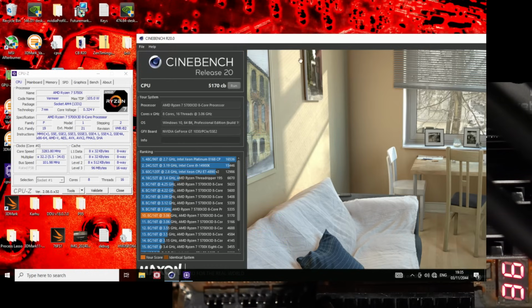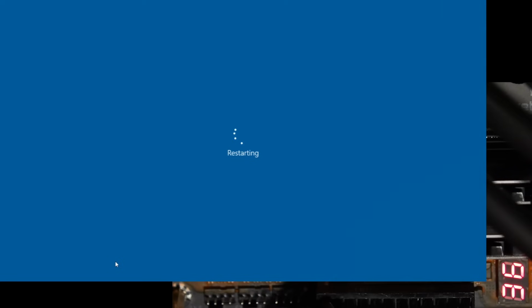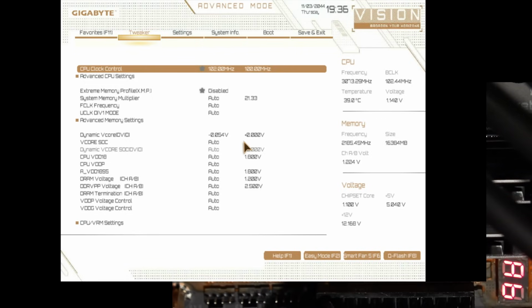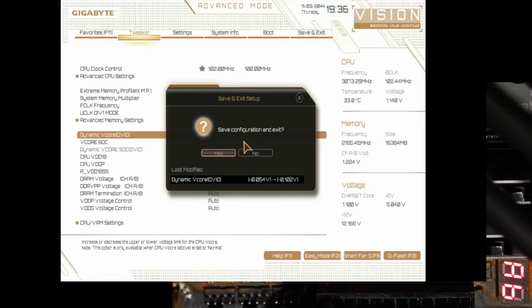Okay, yeah, so the performance basically did not change from the previous run, and, well, I guess let's try minus 100. Obviously, there's minus 75, but my approach to a lot of overclocking is to find the limits quickly. Testing things that work doesn't give you useful information. When you get to something that doesn't work, you can note that down as, okay, that's too much. Whereas things that work, there's headroom, right? It's not like you still have more stuff to test after testing something that works.